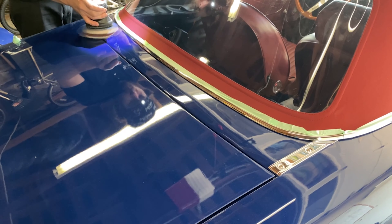After going over all sections with the HDO orange pad and Classic Polish: Classic Cut cleaned up nicely, no haze, but still more swirls than I'd like. Last Cut — no haze, but deep scratches remained. FineLab F-100 did clean up the haze but there are still a lot of scratches left. There's still a weird haze from ProJ, and the Meguiar's 110 section looks pretty perfect. Here's what it was before as a reminder — I'm going to roll with the 110 this time.